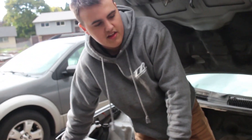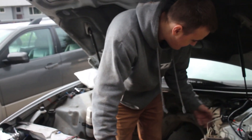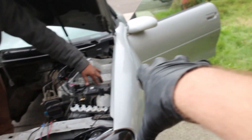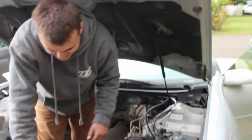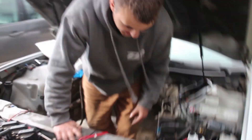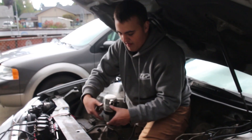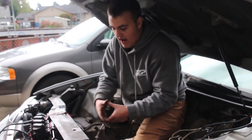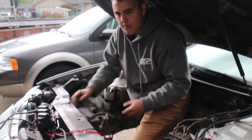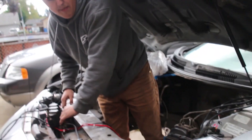We're going to have to figure out the mounting. I don't want to break it like Vince's — I broke it by accident because the SLP design is really stupid. It's a hard plastic coupler fitting over hard metal, and it just cracks. Instead of a normal rubber coupler that a hose clamp attaches to the MAF or throttle body, it's hard plastic over hard metal and it breaks. We could use a silicone coupler between the two — there's no reason we couldn't, and then it would just be a better design.